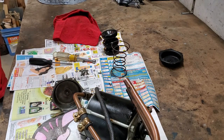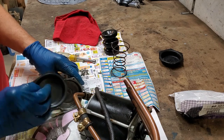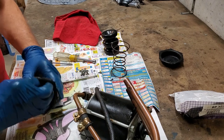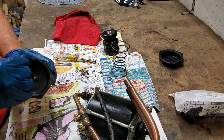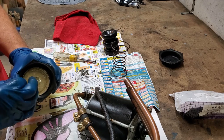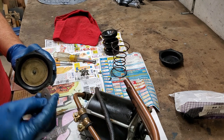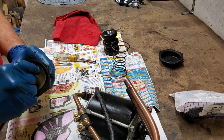We're going to get rid of this one and replace it with a new one. Here's a brand new one — you'll notice the hole is quite tight and everything looks beautiful. The next operation is to get it to press on here, which isn't too hard. I pressed it on pretty easy. Now we want to rotate this just a bit to get the holes to line up — holes are all lined up. Remember this curled edge points away from the clevis, so that goes on next. And we have got another washer — this particular washer also has a little curve to it. Put the little curved washer on there.